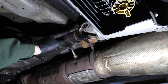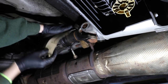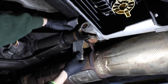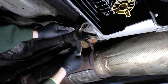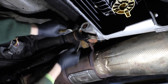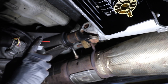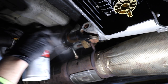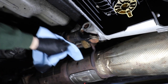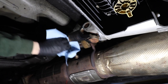The reason the dealership denied this as a warranty repair was because I painted this shaft. So I'm going to take some sandpaper and remove some of the paint. I can see how much the rust sticks out, so I'm going to try and get this a little bit smoother to hopefully ensure I don't have to do this again in another year or two. Now I'll clean up the area with some starting fluid — just spray and wipe it down to get a cleaner working surface and avoid contaminants in the transfer case.